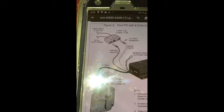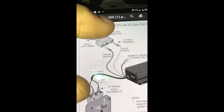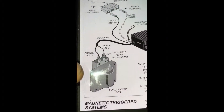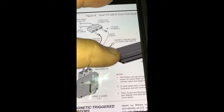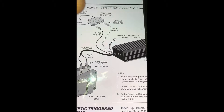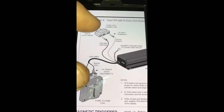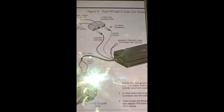The basic connections are simple. The plug coming out of the Fox body coil — you're gonna hook the yellow one up that comes out of the coil. Hook the yellow one with the dark green-yellow wire up to the white one from the box, and then the red one goes to the red one out of the box. The coil just plugs into the connector coming out of here. There's also a thick red wire coming out of the box and that goes to constant power, which I connected from the positive battery source, so that's always powered by 12 volts. The key-on power will come from this source as well — those two wires are all that's needed to get it working in the Fox body.